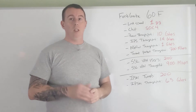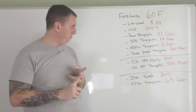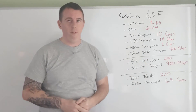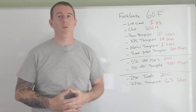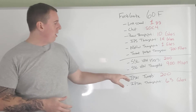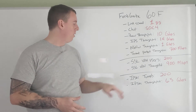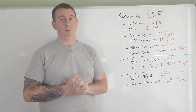The main things these are used for are SSL VPN and IPSec VPNs. This model supports 200 SSL VPN users and has 900 megabits per second throughput over SSL VPN. For IPSec tunnels, it can support 200 IPSec tunnels, and the throughput on those is actually 6.5 gigabits per second.